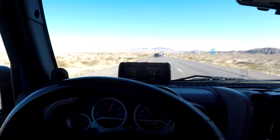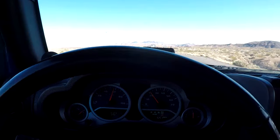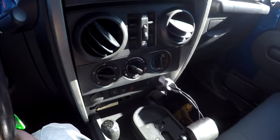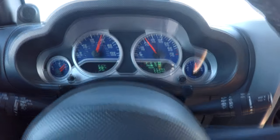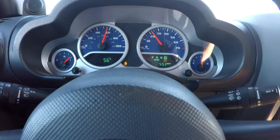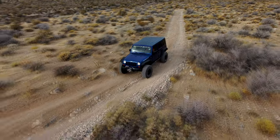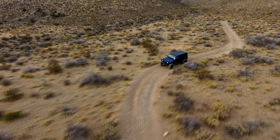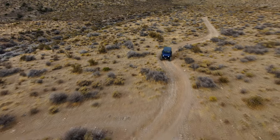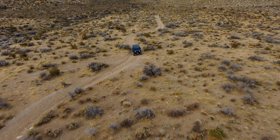The big deal in the single module, and this is probably the biggest difference between the single module and our V3 and V4 board, is the ESP button. Now watch when I turn it on and off. This vehicle has functional traction control. And no, it's not just the light coming on and off, it's got functional traction control. All the active braking functions work as intended. Anti-lock brakes, trailer sway control, brake assisted steering, you name it, it's all there, ABS.